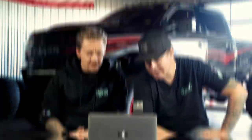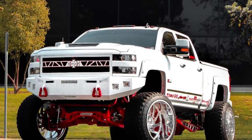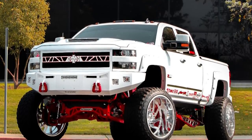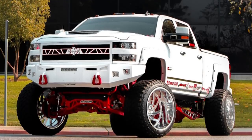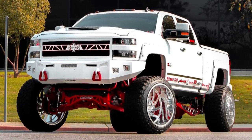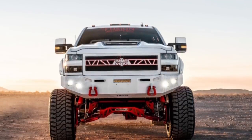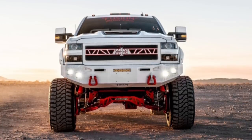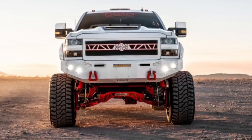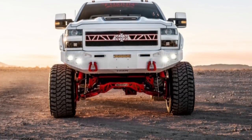On the right, a 2018 Chevy Silverado 2500 HD on KG1 Forge Bounty 26 by 16s, negative 101 offset. Fury Off-Road Country Hunter MTs in a 38 15.5, and a McGaughy suspension lift of nine inches. Also has McGaughy upper control arms. No rubbing, no scrubbing, no trimming, no spacers. He's got custom headlights, a custom grille, tow hooks, McGaughy track bars, powder-coated suspension, painted axles, rear bumper, custom bed cover, and custom interior. Just as much work put in — just not as huge as the Ram.